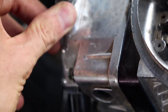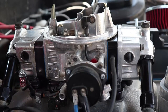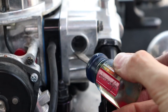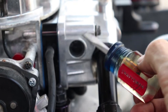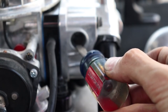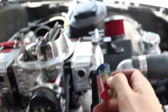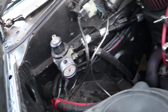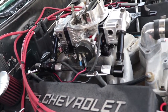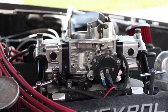Here's the game plan: we're going to revert the fuel bowls back to factory setting, which should be just about to the very bottom of the sight hole. I have mine overfilled specifically for drifting, since it helps during transitions, but just to get this thing running let's lower the fuel bowls back to the stock setting and see if it makes a difference. It's quite simple — all we do is loosen the top screw and adjust the bottom nut. Luckily I have an electronic fuel pump so we can test this easily.